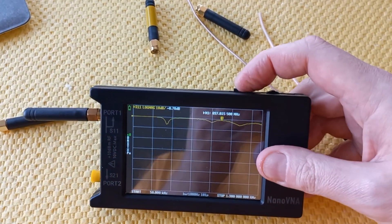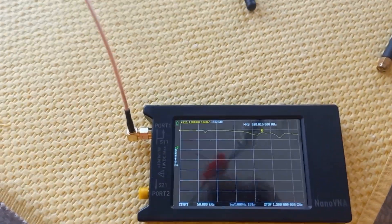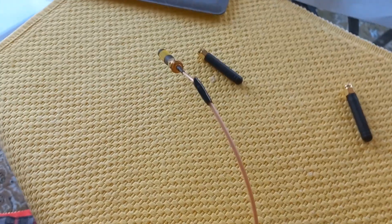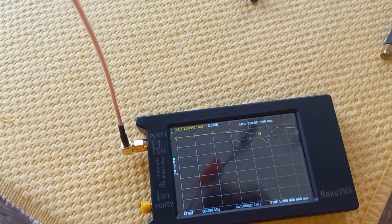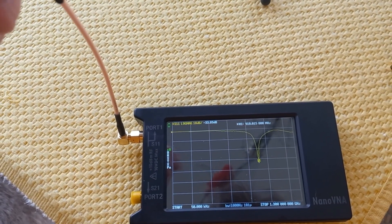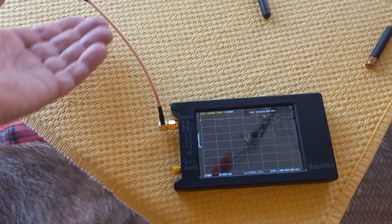Okay, now I'm going to build this cable and I'll be right back. Okay guys, someone has taken my chair. I'm just doing a little test here, want to make sure I did a good job splicing it. Basically, you peel back the shield, solder the center wire together, put a bit of tape around it, then solder the shield together in a couple places. Now it is working, but there's something interesting — look at that. When I'm holding it, why is that? When I let go — well, it's to do with the ground plane.